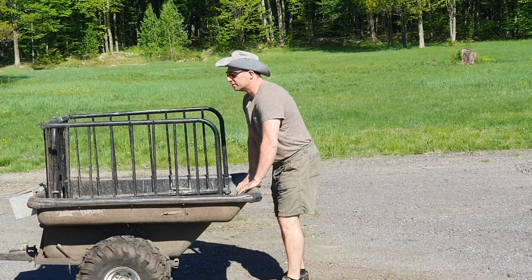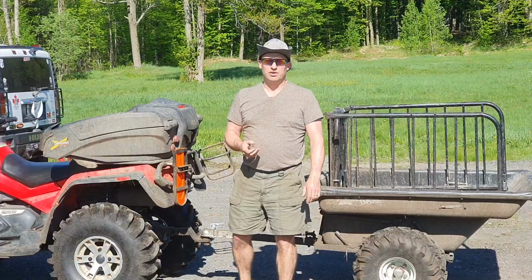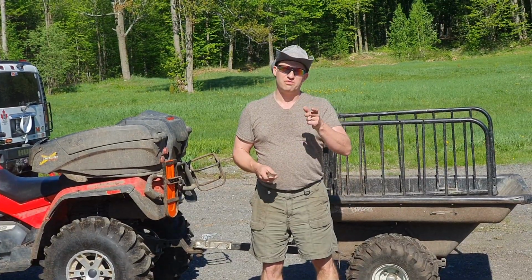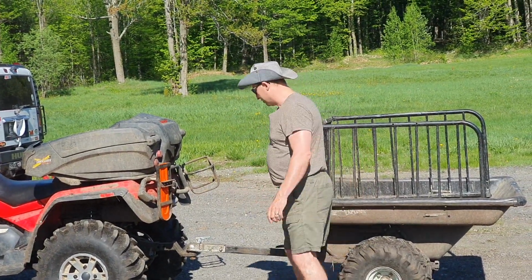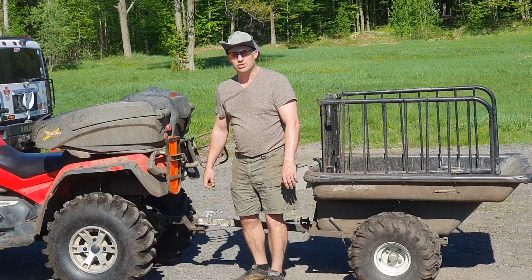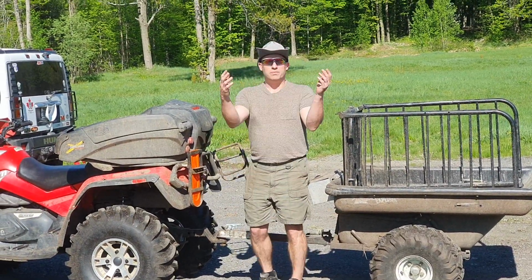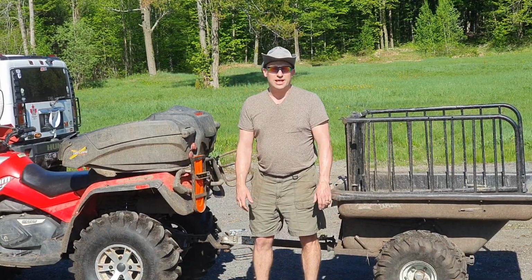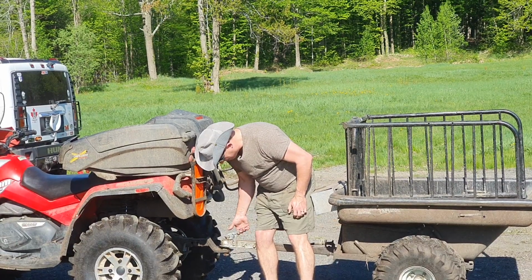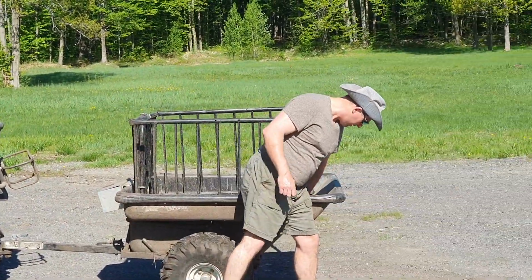So if I go on the back, that can't go anywhere. But to be a proper, safe person who is towing, one of the things that you should always do is you need a safety factor. And it's already built in to the couplers. Right here in the nose, there is a hole for you to take a lock, a pin, whatever you're going to be using, in order to actually pass it through. So now, should there be some very violent bumping, a very jittery section of road that might try and work the actual clip itself, there's no chance that that can come open and undone.